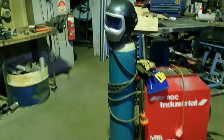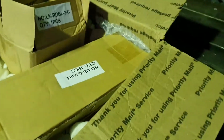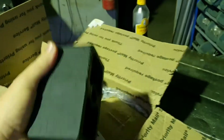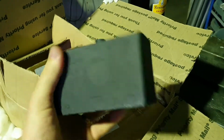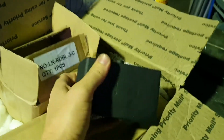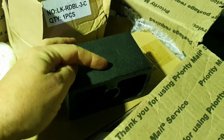I do have 3-inch blocks for it. They've arrived from the States. I don't think we're going to use the full 3 inches of the block. I think it'll be too much and I don't want it to look bum high. So here's our gear. I can't remember what brand all this is, but here's our block. Nice cast block with the drive shaft angle wedge built into it, which is cool. I'm going to section it. I think 2 inches would be better than the whole 3. I'm going to take 25mm out on the saw and we'll go that way with it.